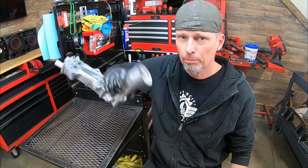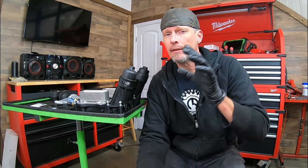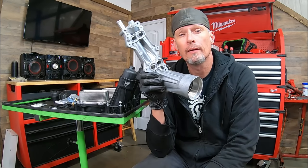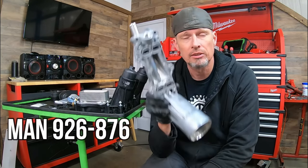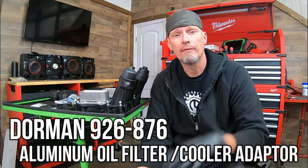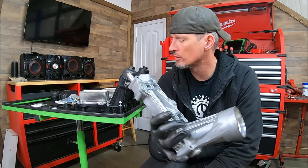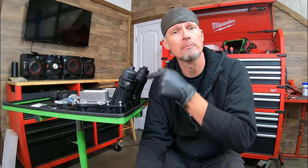Like I mentioned, I think there's more pros than there are cons. So if you ever find yourself having to replace one of these oil filter slash cooler assemblies, remember I've got a lot of different videos on how to do it on certain specific vehicles — scroll through the playlist and see what you can find pertaining to what you're working on. After watching this video, you now know there is an alternative from Dorman, part number 926-876. Make sure to see if it fits your vehicle. You'll save a few bucks and get something made out of metal, made in the U.S., not plastic — not prone to fail over time. It's not a matter of if, it's just a matter of when.